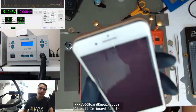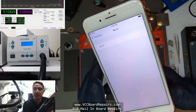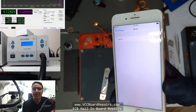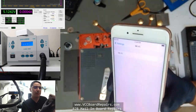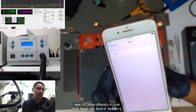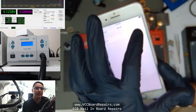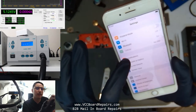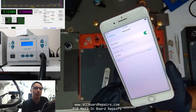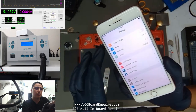I'm going to switch cameras and walk you guys through first the symptoms. We do have to first test everything to make sure the issue is actually present. If you saw my last video, I did just go and start repairing a device that came in for no backlight, but it turns out it had other issues. So it's always important to pre-test. Here is Wi-Fi in the settings — you can see you cannot turn it on. Bluetooth does work. Now keep in mind, Bluetooth and Wi-Fi are on the same chip, so sometimes they both won't work, sometimes one or the other doesn't. Bluetooth is working, just not Wi-Fi.